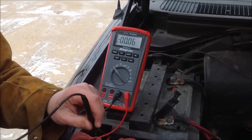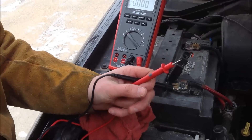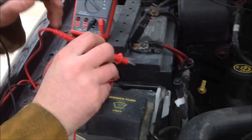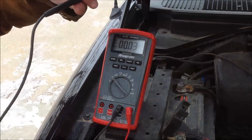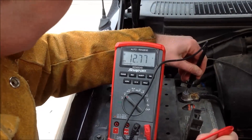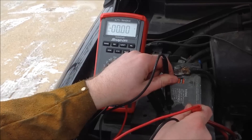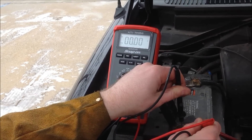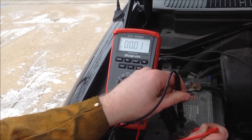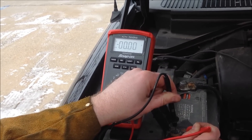We're back to see how our battery is going to do now that we've cleaned our connections. We applied dielectric grease on the connectors and used some battery cleaning tools that are commonly found. We'll see what type of volt drop we have — first off we're just going to test the battery again, and we have a fully charged battery this time. Now our goal on volt drop is to test the connector, and we have zero volt drop — so from almost 0.8 of a volt drop down to nothing. The acceptable maximum is 0.2 volts, and we're at zero, just from cleaning.